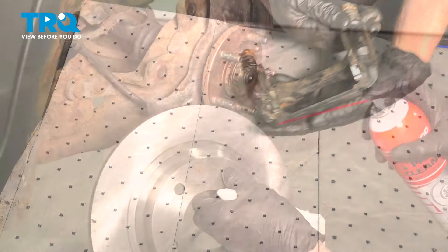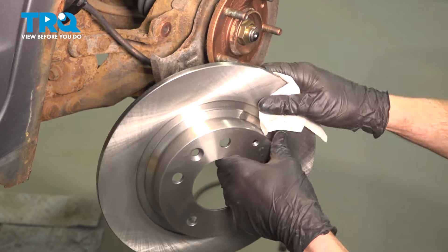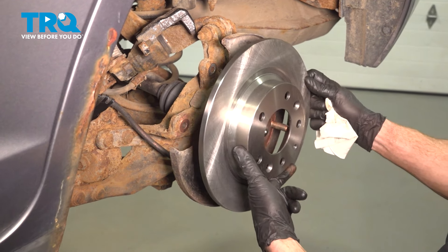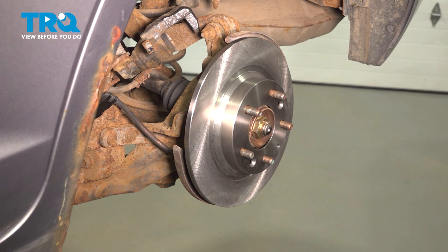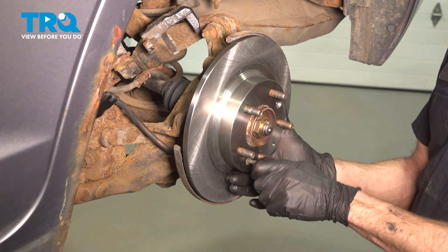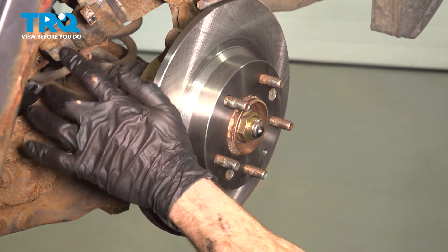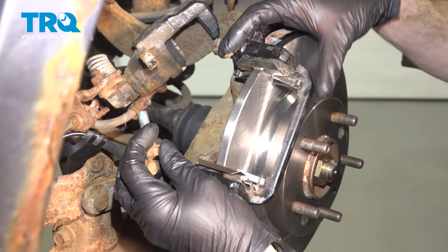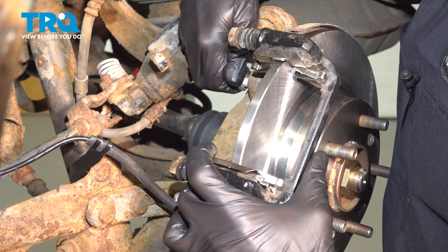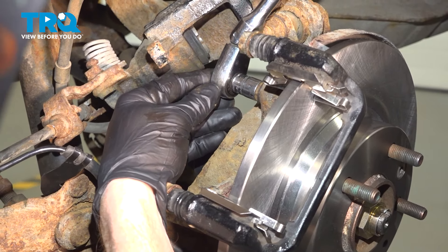Let's get this back over to the vehicle. Continue on with our brand new brake rotor — we'll be cleaning the braking surfaces. Take the brake rotor and put it in position, paying attention to where each of the two mounting bolts go. Let's get the bracket in place. Continue on with your two bolts along the backside — it's a good idea to use a little bit of thread locker on these. Snug these up and torque them to 52 foot-pounds.